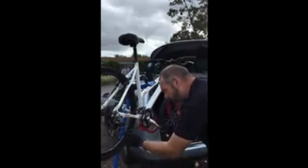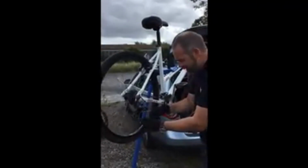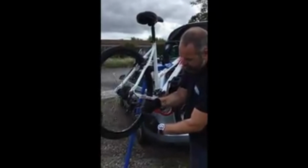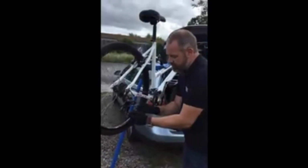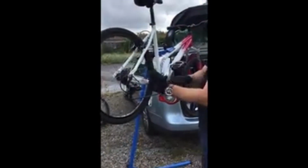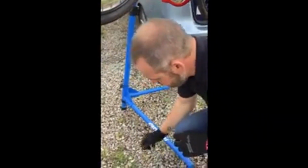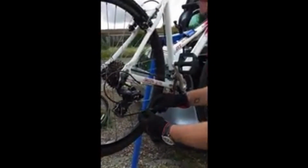And we're going to look for an odd looking link. Now there it is. You can see that link there, slightly different from the rest. It's got 2 little delves in it, and it's got a silver back. This is a slightly different speed connector to the one that I showed you, in that that one's in 2 staggered pieces, whereas with this one a faceplate comes off. So I know full well that this link comes off just by snapping it. Did you see it fall off? Yeah, there's the bit that came off. I'll put that where we're not going to lose it. And then that literally just pops off like that, and then the chain's off.